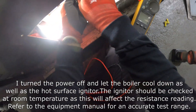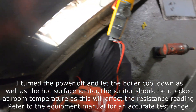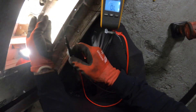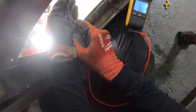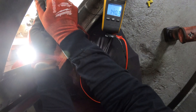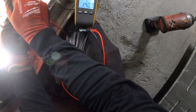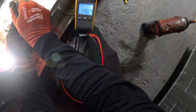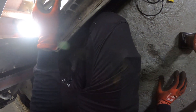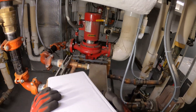What you want to do is isolate this thing. I'm going to check resistance — really you want to check amps too. The manual says it should be between 50 and 80 ohms. Look at that — it's reading 140. They want 50 to 80, so as of right now this igniter is out of range per the manual.